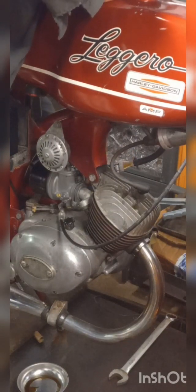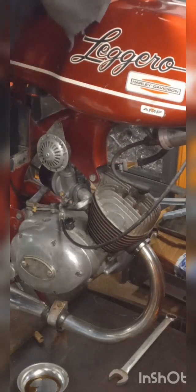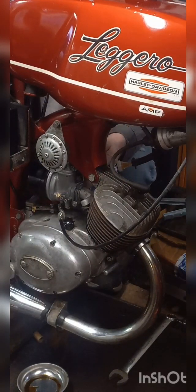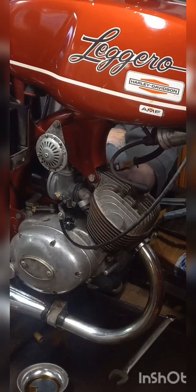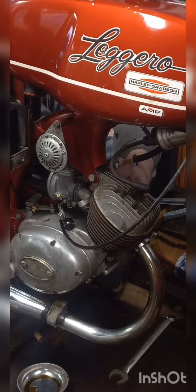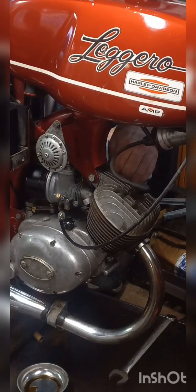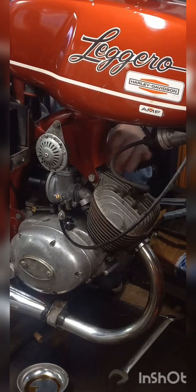I'm going to leave the fuel line and the throttle cable hooked right up to it. There's no sense taking that all apart again. Like I said, I was out here and I went through all this stuff again just to make sure everything was good. I went through this carb again. I actually even took a vacuum tool that I have and went down inside this crank and put some suction down there just to make sure there was nothing filling up the crankcase. If somebody had flooded it out real bad, that would have been another possibility why it wasn't starting.